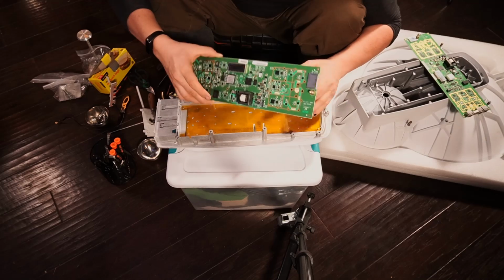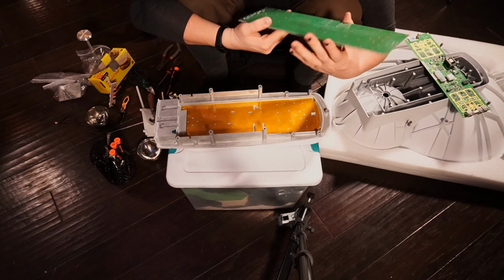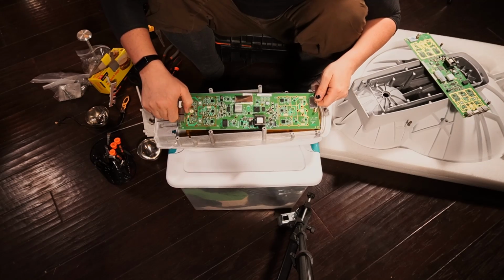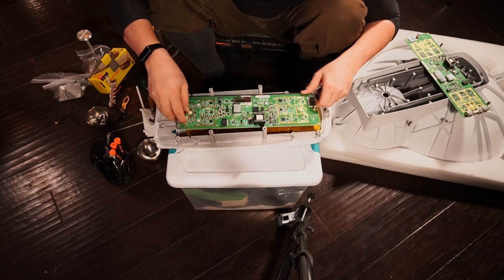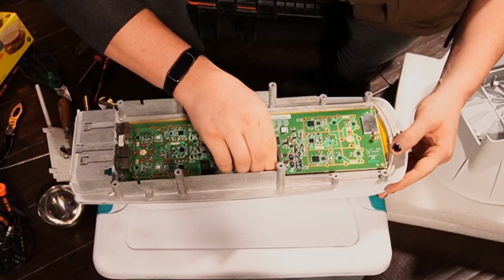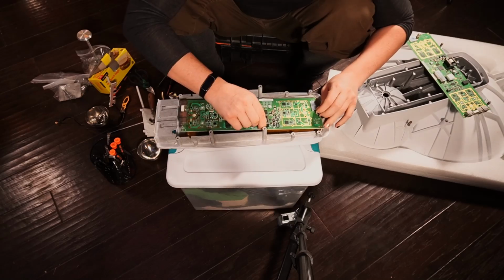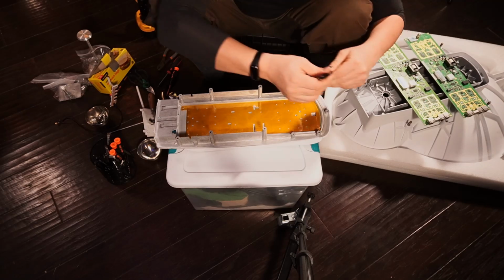But that's it. So now we can take a look at the coupling here. You can see here, this is a giant piece of thermal mass, okay? Now you'll notice that there's no coupling. In fact, this just rests on here, and the screws themselves are what help bring this in contact with the thermal sink here, the heat sink, right? Now, where most of the heat is occurring, which is in the RF switching sections, in the amplification sections, there's a lot of screws on here pulling this tight to marry it to the surface. So there's no thermal compound in between the two. There's only Kapton tape. And you also notice that some of these are actually slightly injured from manufacturing. I'm gonna put this aside now. And it looks like the Kapton tape. I wonder if I can actually lift that for a second. Let me try here.